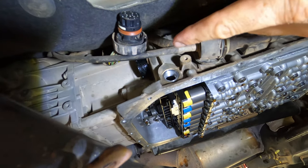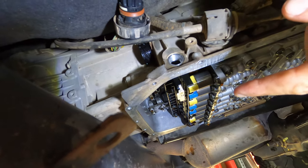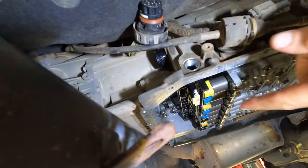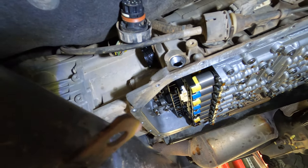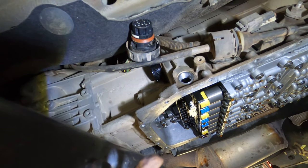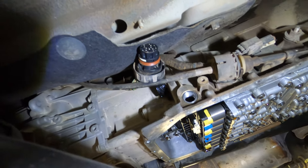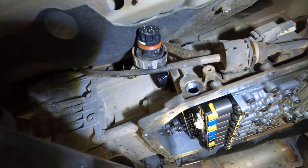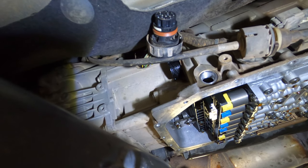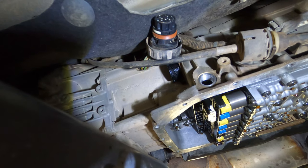And yeah, it's probably the easiest way to know, but these can be quite tight to push in as well, so you get a little bit nervous doing it. Just take your time, and if it doesn't feel right, don't rush it, and just double check everything. Also importantly, just take note of how far in the sleeve sat originally so that you're not second guessing yourself.